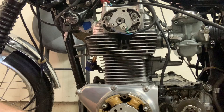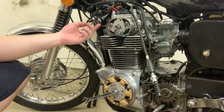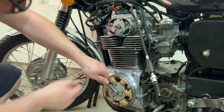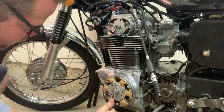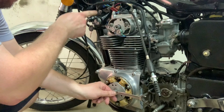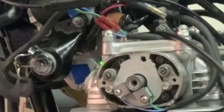Let's move to this bugger — this one sucks. It's kind of the same song and dance except you adjust this one totally differently. Turn my key on, let's go around to my left — make sure my left is good. Just like that, and come around — it's going to go off on LF. Man, that is dialed in. Now what we want to do is rotate it over to the F mark on your stator and watch that green light. I'm going to move my rotor to F and let's see how far off we are here.